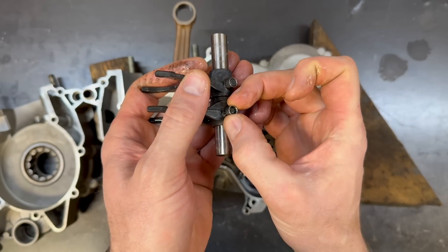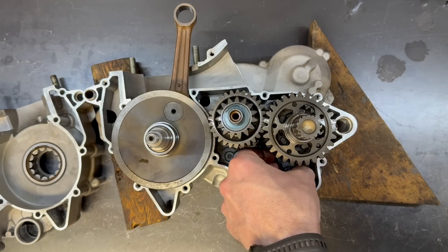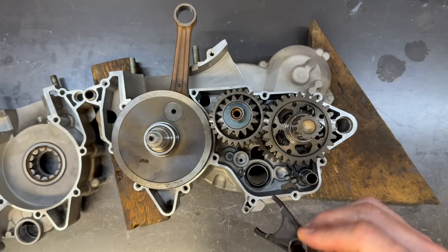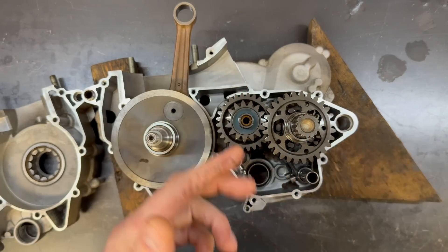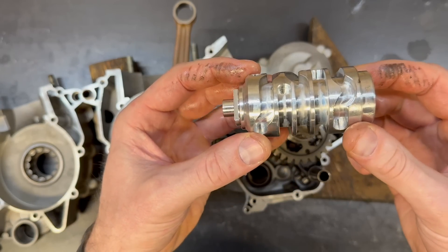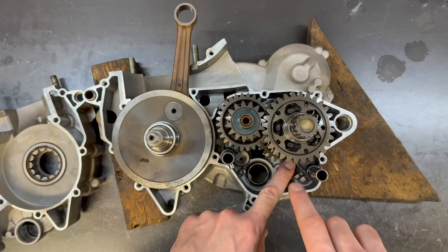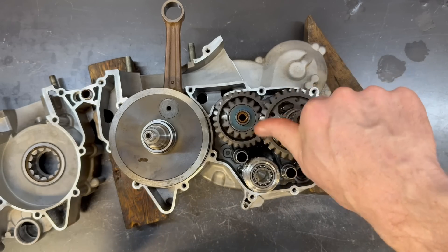Now we have our shift forks. Beware — these little collars go on there. I leave this together, but it's really hard to screw it up. I'm just going to put this shift fork in there, leave it rotated back a bit. This shift fork goes here — I'm going to drop that in there. Note that I'm keeping this back so that I can install my shift drum. Now we have our other shift fork with the little roller. I'll drop that in — all the way down. Now, our shift fork and this pin. I've left them apart. This side is going to go down, so that's going to mate up with our star wheel. We'll drop that in place. I should mention this one can be a little bit tricky because you have three grooves — this one, this one, and this one. These are not grooves; notice how they're flat. You want to make sure that these shift forks go in the top, middle, and bottom groove. This one's the bottom, this one's the top, and this one's the middle. Drop that into place — that just slides in. The shaft can go down, and we should have a free spinning transmission just like that.